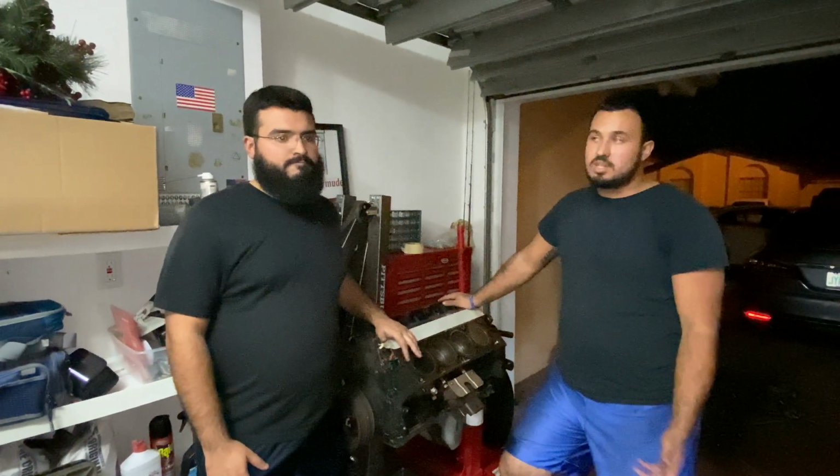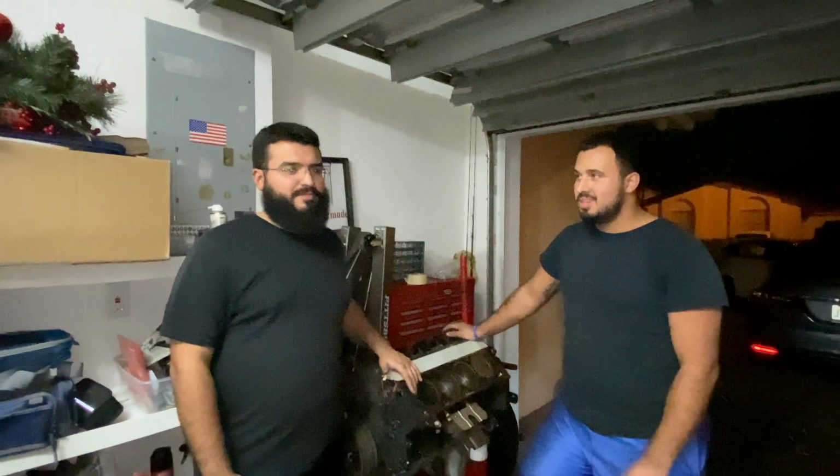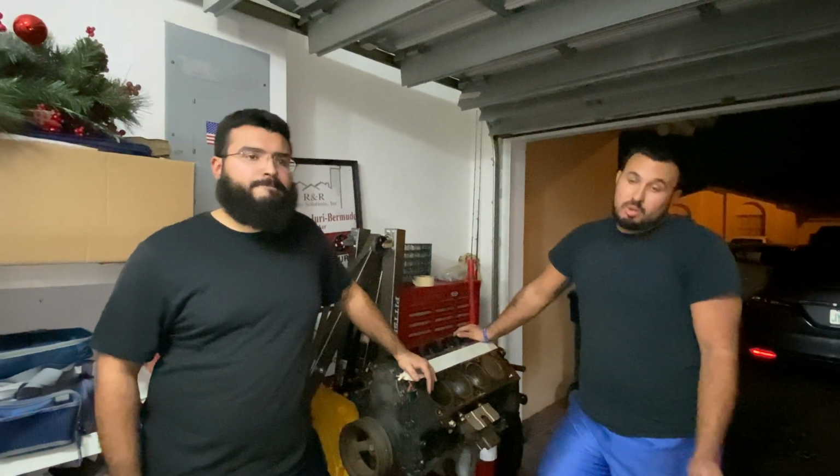I'm meeting with a buddy of mine who builds transmissions. We're gonna see what he could do for us. We were gonna go with the 4L60, ditched it. We're probably gonna make more power than it could hold. It's gonna be unreliable. Then we're gonna be spending double the money for no reason. We're going with the TH400.